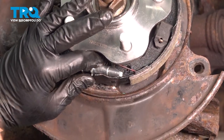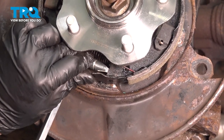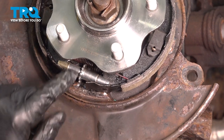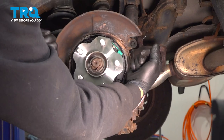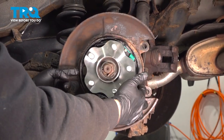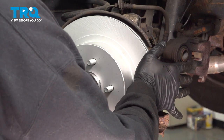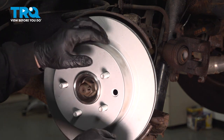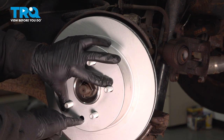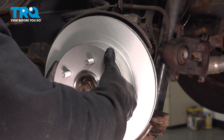Now we have to expand our shoe. With the adjuster set at the lowest setting, go ahead and bonk the shoes to make sure they're seated. Check the spacing between the shoes and the backing plate. Now install the rotor — line up the brake rotor and slide it on. For adjustment, rotate the rotor and adjust the sprocket or little gear through here to tighten up those parking brake shoes — you'll just want to feel a slight amount of drag, and that's what we're feeling right now.